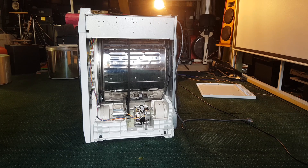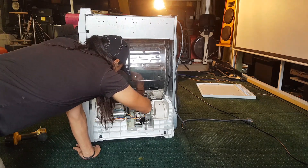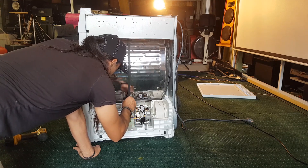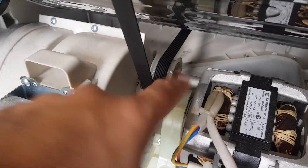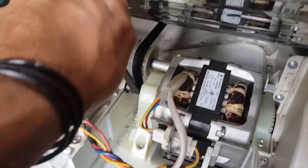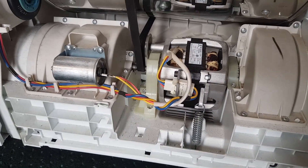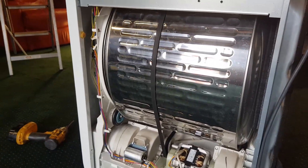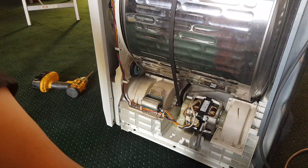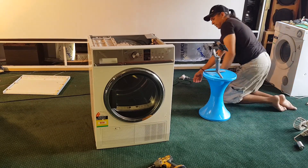The item's looking pretty good. So that's spinning like that. Or maybe the idler is... let's have a look. The idler's looking intact — I can see it just here. It's looking good. I can turn it and that's working fine. So what's the deal? Maybe it's the motor — the motor's just not turning. The other thing it could be is the capacitor, but it sounded like something was turning.